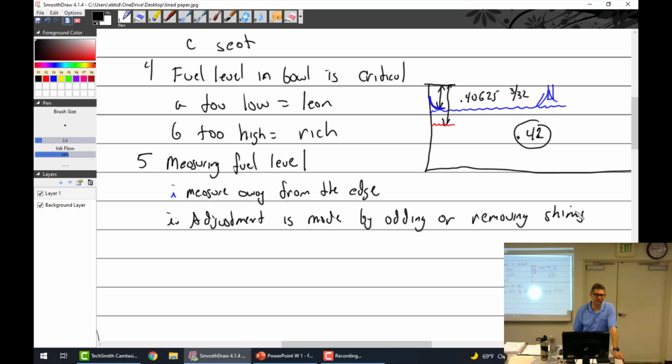And so what you do is, like with this new kit I bought, for whatever reason, they want you to take the seat out, take the shims out. They give you two shims, a thin one and a thick one. And it says it may need thin, it may need the thick, it may need both. And oh, by the way, make sure that when you screw in the seat, it's at least 6 inch-pounds of drag going in. I'll tell you from experience, the seat's $100 and you only get about two shots at it before you have to throw it away because it's got a nylon insert in it, and after that it's going to go in at less than 6 pounds, so get it right.